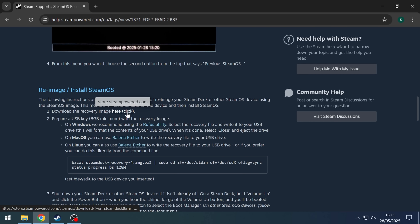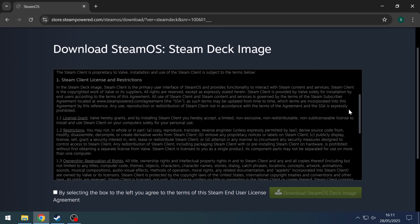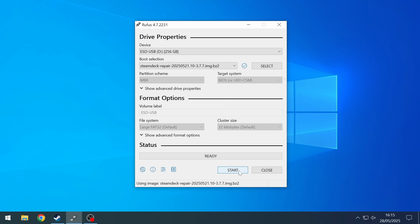There's a reason this is not a tutorial. The first thing I did was download the Steam Deck OS image and flash it to a bootable USB using Rufus. After that I plugged it into my PC, disabled secure boot in the BIOS — or in the case of my motherboard, just enabled CSM mode instead of UEFI — and booted to the drive.